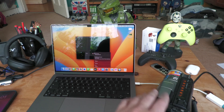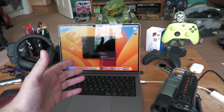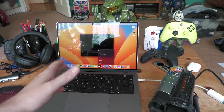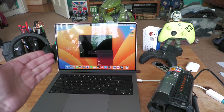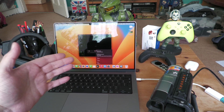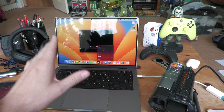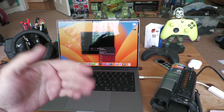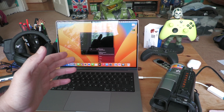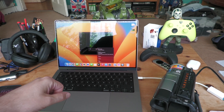So it goes to show you can still do this in 2023 — capture your precious old memories to a Mac. If you've got a Windows-based system you won't be using these same adapters, but you have the same FireWire problem. The good thing about PCs is you can open a desktop tower and stick in a FireWire card — in 2023 it's still feasible; Windows still supports it. If you've got a laptop you'll be looking at different options. Now I must make it clear: those fake cables advertised as USB to FireWire do not exist as a real solution — if that worked, they wouldn't have bothered inventing FireWire.